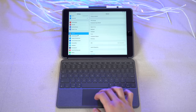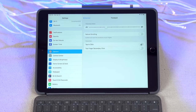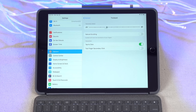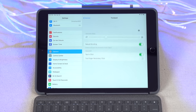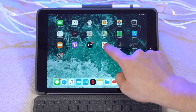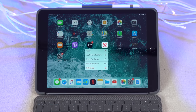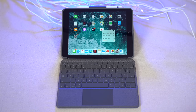Thankfully, you can go into Settings, then General, then Trackpad, and enable tap to click, which I fully recommend. Alongside that setting, you can adjust tracking speed or toggle natural scrolling if your swipes feel reversed. There's also a two-finger secondary click setting which is extremely important — you no longer have to tap, hold, and wait for additional options. You simply use two fingers to tap and it happens instantly.